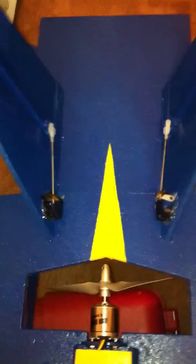For the servos I have these two HS55 servos — they are standard gear servos. For beginner pilots I really don't recommend these servos. They're okay for rudders, but if you have them on control surfaces that stick out — especially on the RC Powers F-22 — and you have a crash, you're going to strip this servo out in no time. So I only use them for the rudders. Instead I've gone to RC Timer metal gear servos and Hobby Parts metal gear servos. They're both fairly cheap — about $7 a piece — only weigh a few grams more, but they will hold up and last the duration of your plane.